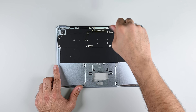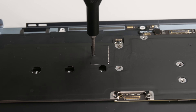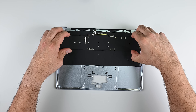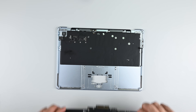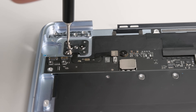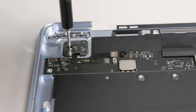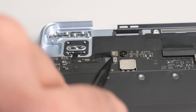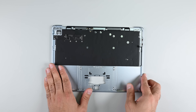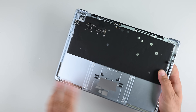The logic board is up for removal next, held in place by several screws and a tiny hatch in the middle which hides the interposer press connector. With the logic board free, it lifts right out. Underneath all that is the second most difficult component to reach inside the MacBook Air: the Touch ID button. There is no way to remove this button without first disassembling the top half of the device. The most difficult part to reach is the keyboard and top case, which requires a full disassembly to reach.